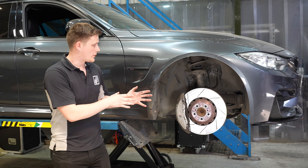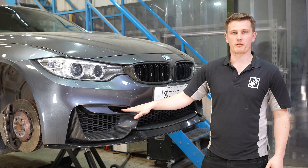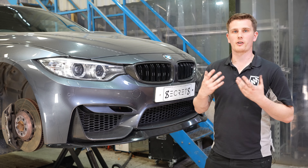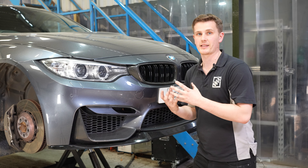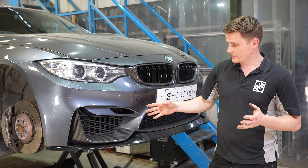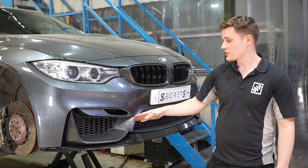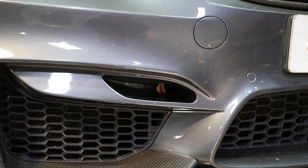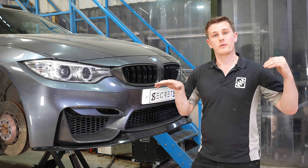So that's exactly what we did. Let's take a closer look in the wheel arch and show you what we've done on the front bumper. We started off with the GT4 brake cooling duct, but the ethos behind this build is we want everything to be OEM+, as though BMW Motorsport would have designed and made that part for the road. So we handed the car over to our friend Ben, who owns a really good body shop down in Knutsford, and gave him the task of fitting these carbon air ducts — exactly in the front bumper, but looking like they came from the factory. He's put them into the back of the bumper, come through the front, and blended and painted them into the standard front bumper. This now means we have a brake duct that takes direct, perfectly clean, cool airflow straight from the front of the car and guides it into the back of the discs.